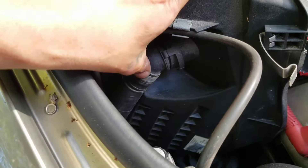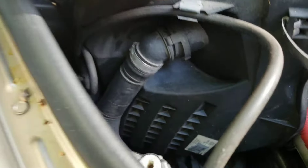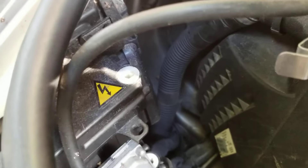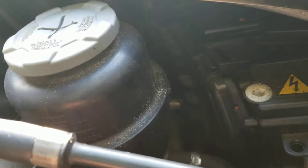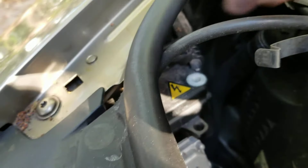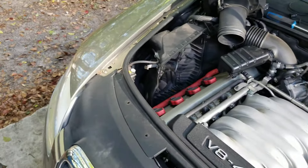I've got it all pulled away — you see you've got one hose here and another breather hose there. We really don't need to remove all that stuff because we're just reaching into the headlight. There should be some tabs at the bottom end of it. It's kind of reversed on this side — the tabs will be up top on this side; you can see them right here. On the other side they're going to be on the bottom. There are two of them; you just flick up the two and the cover will come off.